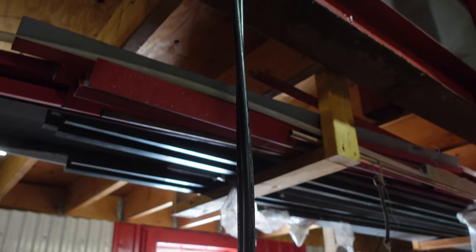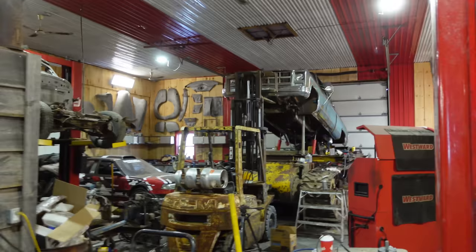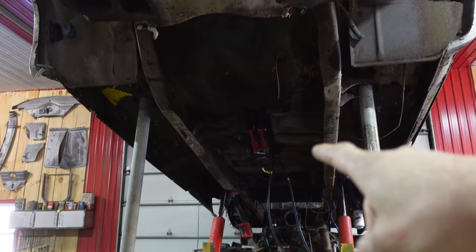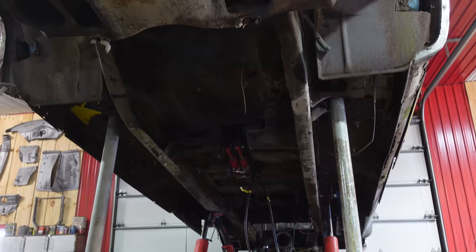The air will go up into the hose, nice and simple, and then just pull and push until it doesn't bounce anymore. Then all the air is out of this and out of the hoses. Then for the truck cylinders, I'll do the same thing. I'm just gonna hold the containers of ATF in the fittings as I move the handle back and forth. The bottoms are a pain to get unhooked, but where they're connected to the levers is not. So flip it over so the fittings are up, and then attach the hoses loosely, squeeze the hoses, put out the last little bit of air, and that should be it.